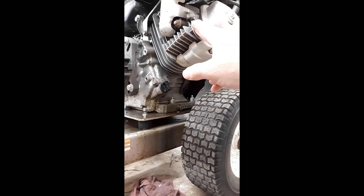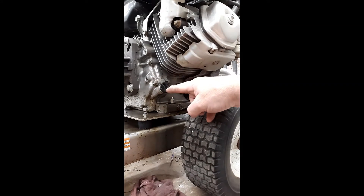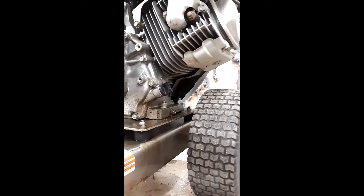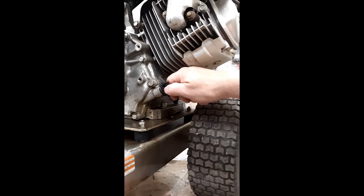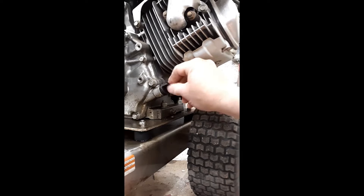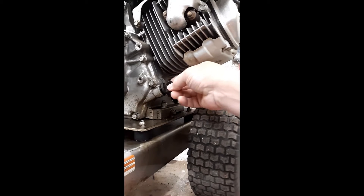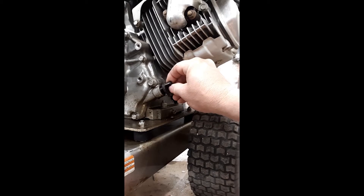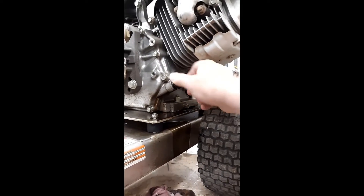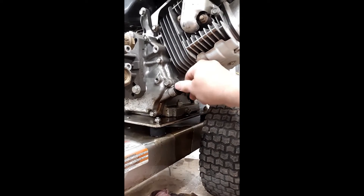So that's one issue. The second issue is gasoline goes down into the crank, and I'm going to show you something here real quick. I'm going to make a mess, but the best way to know if this is what's occurring on yours is to put cardboard or something underneath the machine, take the oil plug off, and it's just going to come gushing out. You see how thin that is? So what it is — you now have gasoline mixing with your oil inside of the crank.